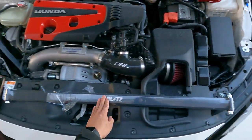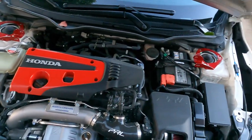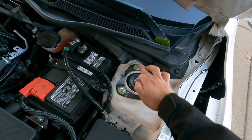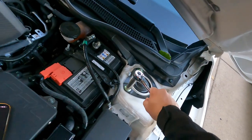This is how the strut bar looks — it's not just plastic. I can't wait to actually mount it on the car. These strut bolts right here — we're going to remove all three of them and they're 14 millimeters, so let's start taking these off.